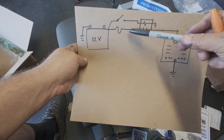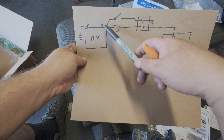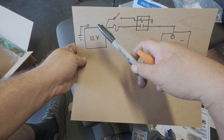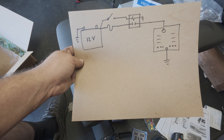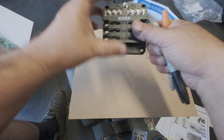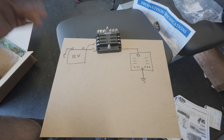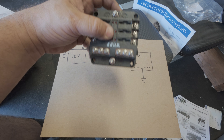The ground circuit is optional — everything works fine without it, though the LEDs may not illuminate. I use it because it makes grounding so much easier; I run one solid ground to the engine block and then ground everything else right there on the fuse box instead of drilling into the body. For the red wire, run it to the fuse and then to the battery, back of the alternator, or the starter — any of those three are solid 12 volt sources. Mount the fuse box somewhere hidden but easy to see in case a fuse blows.